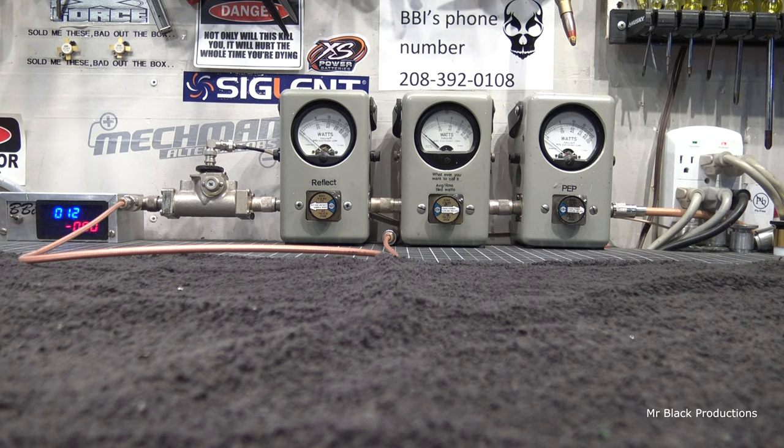And I said, you know, it's all about wire routing, right? So I don't know if I pointed that out or not in the video segment. I don't think I did with the coax, where I very carefully routed the coax for everything. All the coax for the radio equipment goes up the middle of the truck. All the speakers and all of that kind of stuff goes on the exterior of the vehicle, towards the edges and up and down the pillars. The only place that even remotely came close was over in the rear corner where I brought the coax down from the roof. And I set that far enough away.